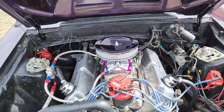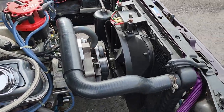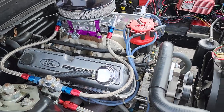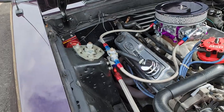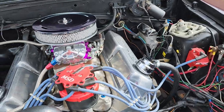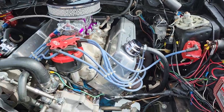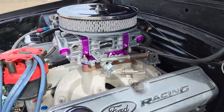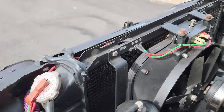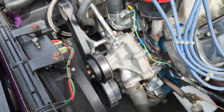I just had it sitting still taking pictures of it for 10 or 15 minutes, and with the massive electric fan on, it never got over about 150 degrees. You can see the fuel regulator from Auto Meter going into a Brawler carburetor. There's your MSD ignition coil and distributor. There's that big old electric fan, and a little overflow thermostatic switch with a dial on it to adjust.